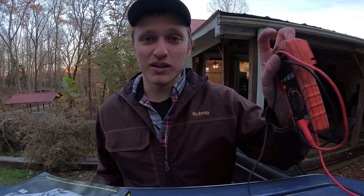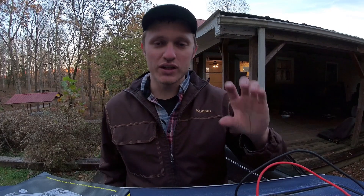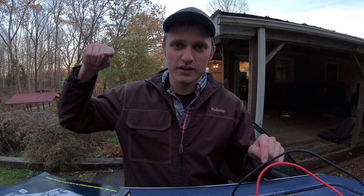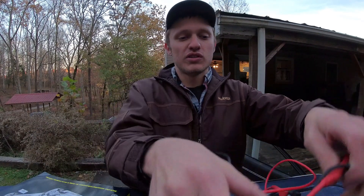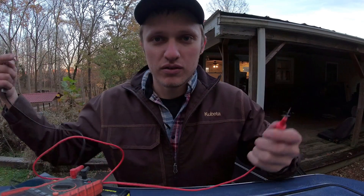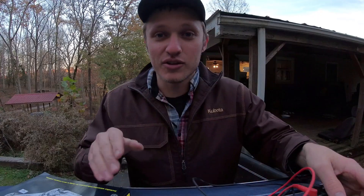How do you test wiring? There are two ways. One, you want to see if you've got water coming out the other end — so with a multimeter that tells you voltage, you can see if you have power at the component you need to turn on, like a headlight. The other way is called continuity — making sure that one end of the wire is reaching the other end. You want a multimeter that beeps when you touch both ends of the wire together, confirming electricity reaches the other end.